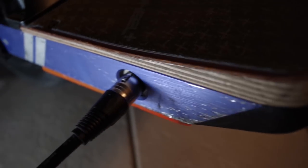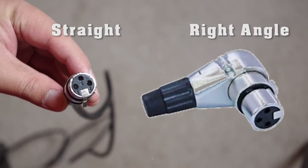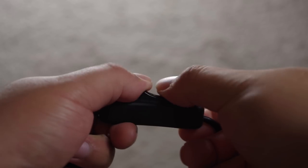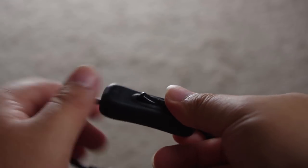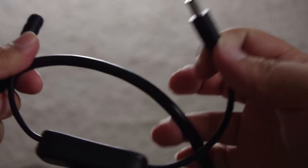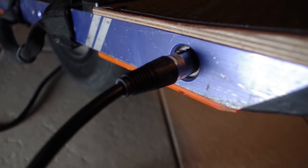The straight XLR cable you see here can cause damage to the one wheel if the rider has to bail out. It's best to use a right angle or 90-degree XLR cable for a charge and ride system so the one wheel can safely roll over in case of a wipeout. It's also best to include an on-off switch and a quick disconnect — the on-off switch allows the rider to shut off charging in case of an overcharge situation, and the quick disconnect will disconnect the cable in case of a wipeout so the rider isn't tethered to the one wheel.